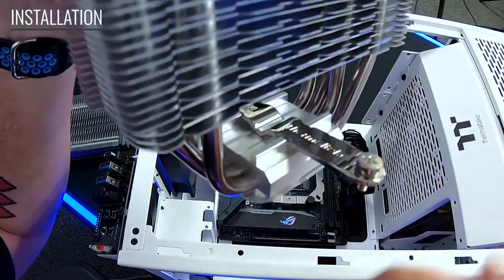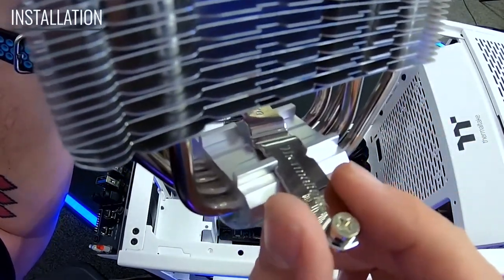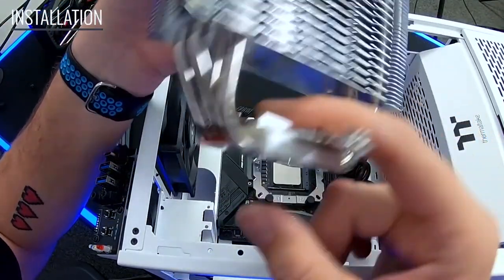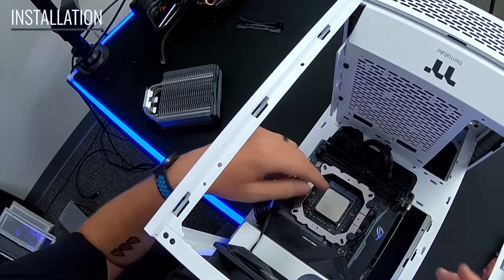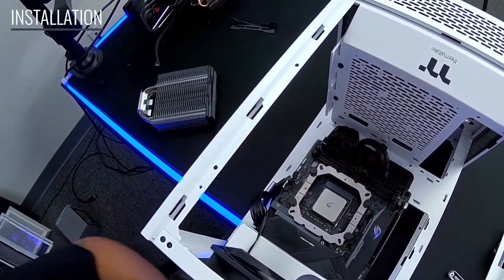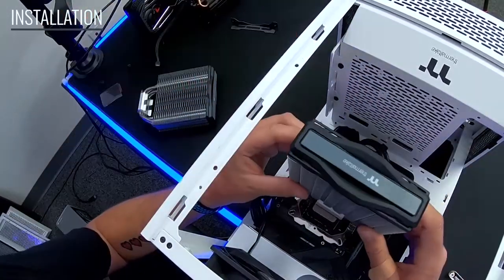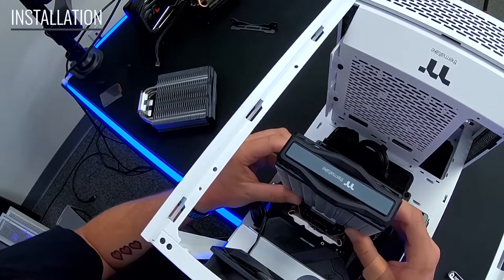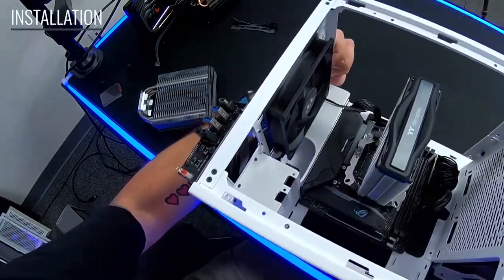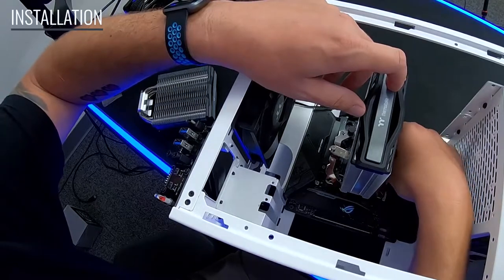With the particular bracket you're going to have it sit down in here and you'll notice there are little notches as well as a kind of teeter-totter tension mechanism that prevents it from slipping out of its groove as it tensions down to secure onto your CPU. We've got our Ryzen CPU right here — put a nice little bead of thermal paste on there, make sure you remove the protective cover for best cooling. I'm just going to take it and line it up with where my CPU is and give it a little smudge. Now we have our retention bracket ready.